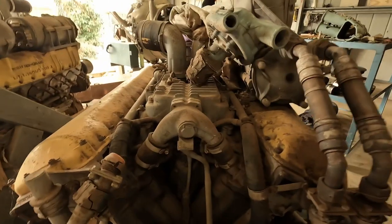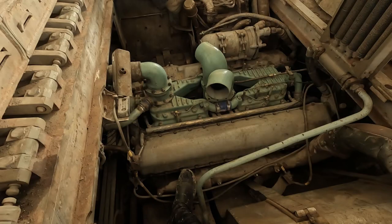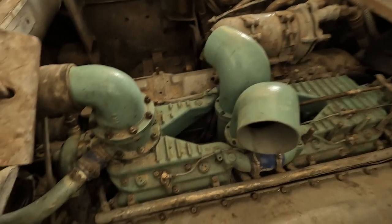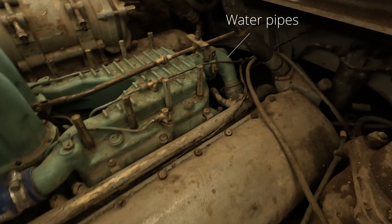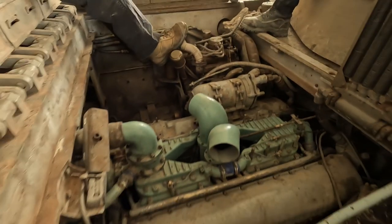The carburetors on a Centurion however are not so easily removed. These ones are called updraft carburetors — from here on out we'll simply refer to them as the worst kind. The intake manifold for the engine sits atop the carburetors, and the intake and carbies cannot be removed from each other while in situ. This means a near total strip-down of the top half of the engine must take place, including throttle linkages, choke linkages, and most importantly the water system. Due to the lack of lifting equipment and the extreme weight of all the components, we decided to allow the tank to move to Victoria before being fixed. And so began our road tripping adventure.